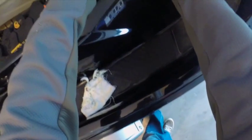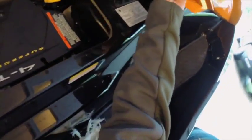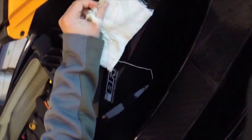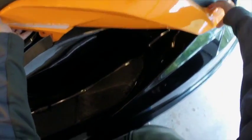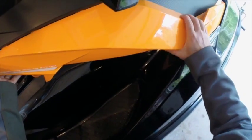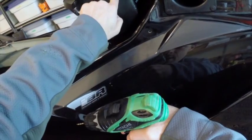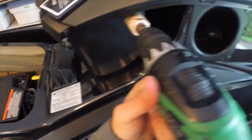Next, remove these two plastic darts. This one you can access from the other side — just push it a bit. Once you have that off, slide it forward. Because the screws are off and the darts are removed, it should just be able to pop forward. I've marked out where I want it to go — they suggest right around here on the side of the glove box. And drill away.